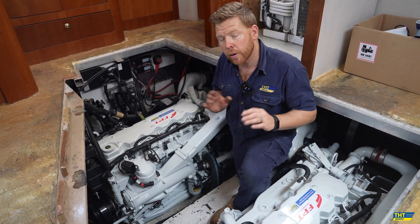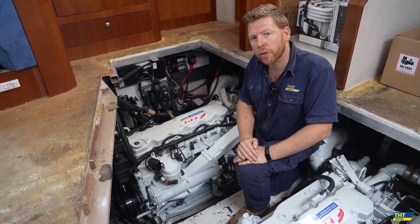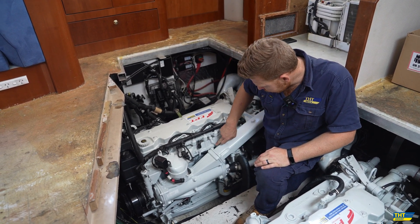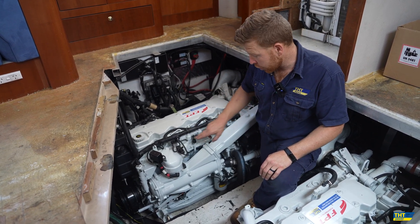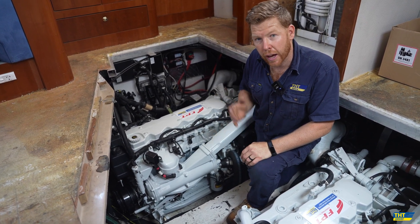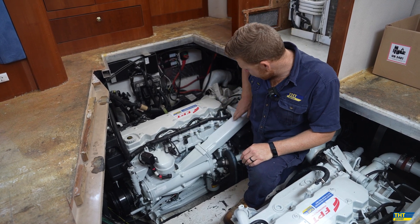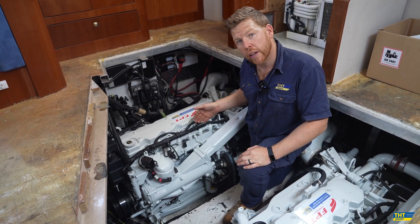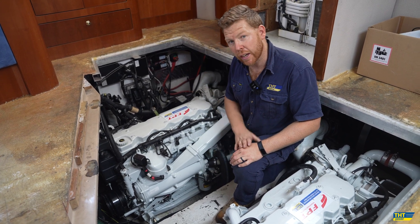That's where it gets interesting. A common rail fuel system runs at incredibly high pressure, so you want to ensure nothing is opened on it. A single line comes up from the high pressure pump into the common rail situated here. At one end of the common rail, we have a rail pressure sensor, which gives the ECU information about the pressure of fuel sitting in the rail. At the other end, we have a relief valve — if fuel pressure is too high in the rail, it discharges back through the relief valve and back to tank.